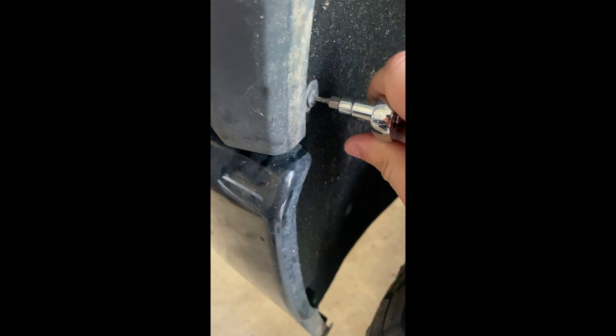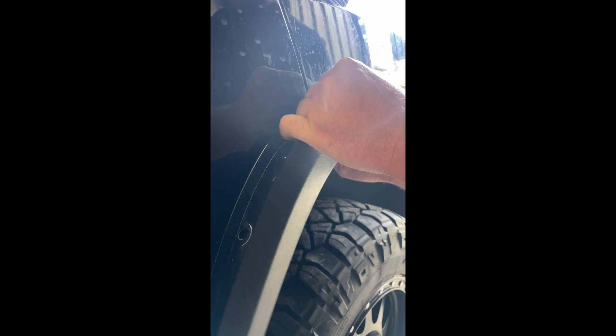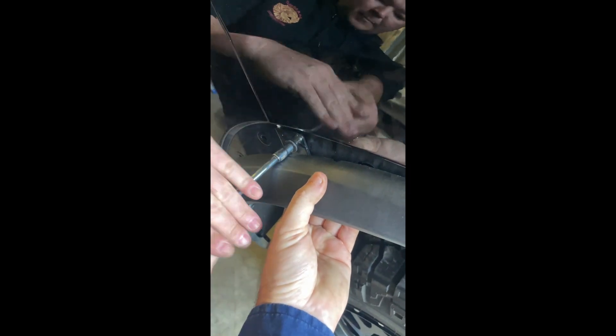Just cracking on here — there are a few plastic screws just underneath the guard, so rip those out and that'll give you access to one pesky screw that sits behind that guard. Once all the screws are out, just unclip it — there are a couple of clips behind it — pull it out, and that will expose a bit of space to get to this screw.